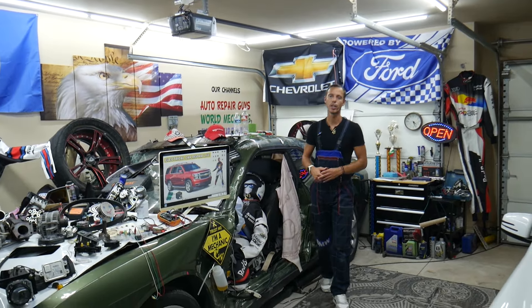So the HID headlights fuses and relays — where you can expect to find them. We will demonstrate on this generation Chevy Tahoe and Chevy Suburban right here. These two models are practically built on the same platform, so it should work for both. The main difference is that the Tahoe is a little bit shorter and the Suburban is longer. Quick advice: there will be five hidden fuse boxes in that SUV that most people — 9 out of 10 owners — do not know where they're located. Go ahead and open the hood. Facing the engine on the very right side, that's the driver's side, we have that cover. Open that cover and underneath you're going to find a fuse box with a layout like this one here.